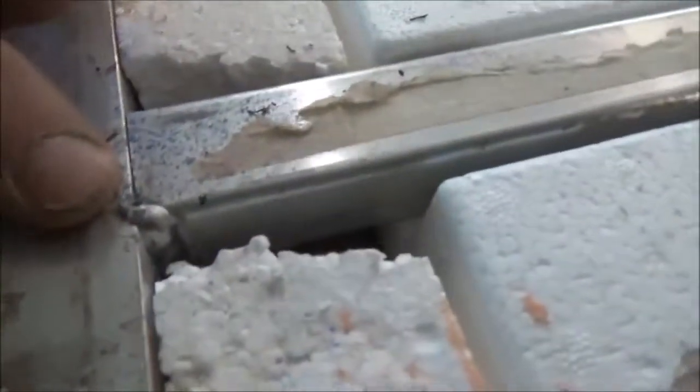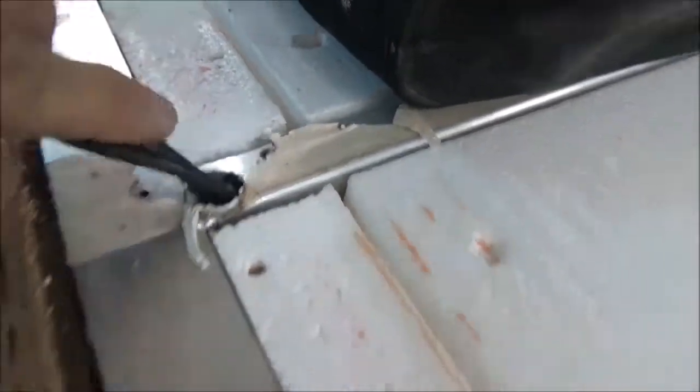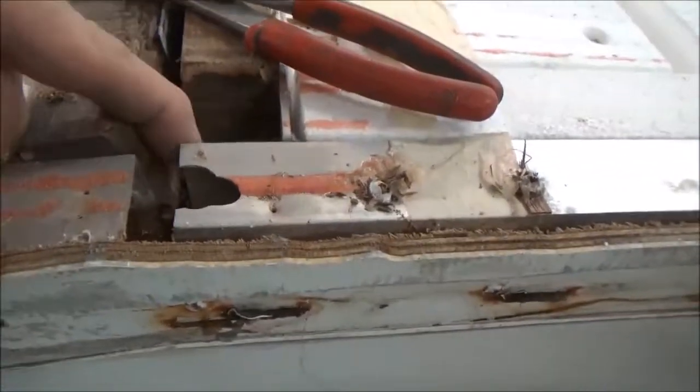It's not like they just got that little booger weld right there. See it? That's it. It's not like the whole thing is welded, and those things pop. And they drill holes through it. They don't protect these holes, so we're going to have to figure that out as well, so we don't end up with breached wires. And like this one here, even though this is aluminum, this is not even joined together. And yeah, it's come off. You can see inside there, it's not welded down there.